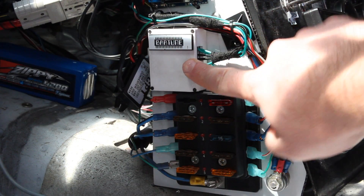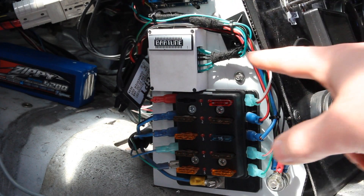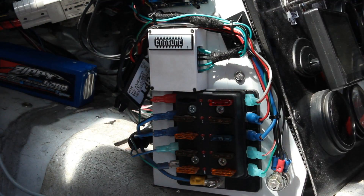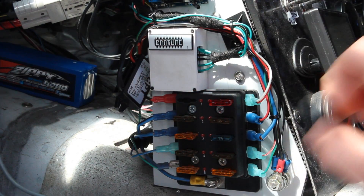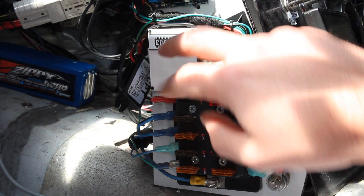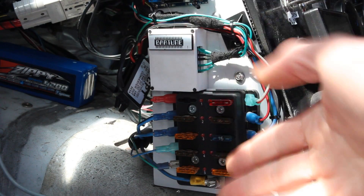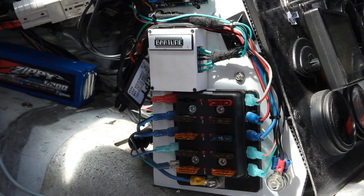The other thing we've got is the Bartune Engineering little controller, and what this does is it's hooked into an output from the ECU. That output triggers this to run under PWM control. This is effectively a solid state relay — or as Alex calls them, fancy MOSFET things. There are actually two circuits in here, however we've joined them together to load balance or for redundancy. In my case we've just doubled them up because we only need the one output.